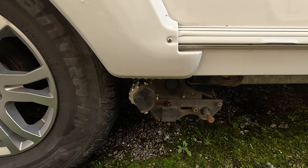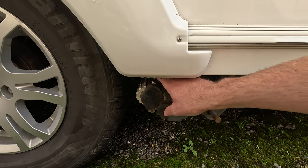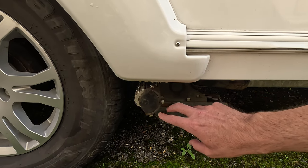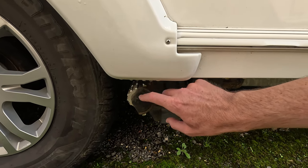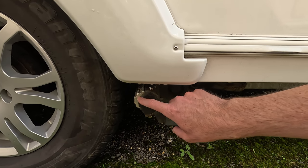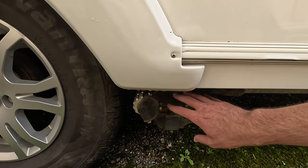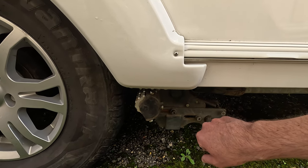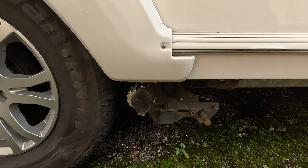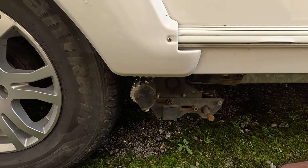But hopefully that will give me the indication whether it's the bearing. And there's only one in this, so the other side of this silver bit is a cross hatch bit which then connects into the actual drive motor. So there is only a bearing on the outside, but at least that will tell me whether it's that once it's under load or if it's something else with the gearing of the motor mover itself once it's engaged. But yeah, what we'll do is we'll get this out and transferred onto the other side and see what happens.